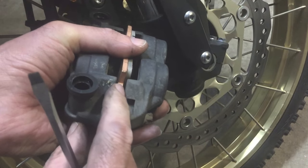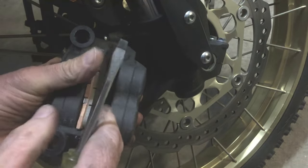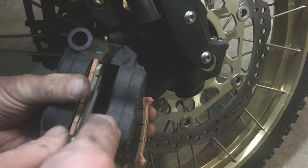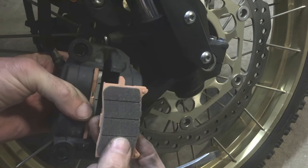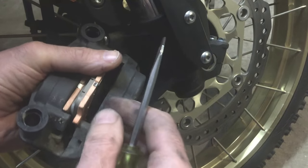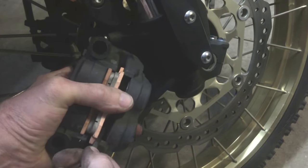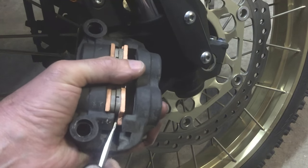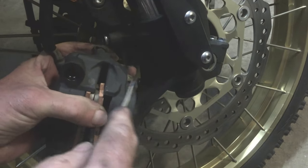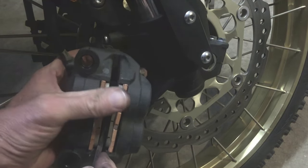You can see that there are little slots in the caliper that those tangs go into. There's a sort of a spring clip on the bottom so those pads need to be pushed down to get the tangs to clip into their spots. I'm using a screwdriver in there but I'm very careful not to damage the face of the pads. Getting the second pad in is a bit of a fight. Got one tang in — now I'll need to push the pad down on that spring so I can get the second tang in. There it goes — very satisfying.